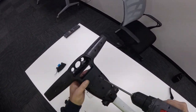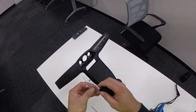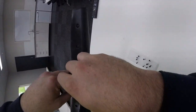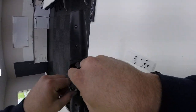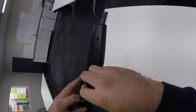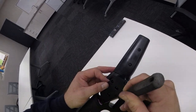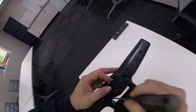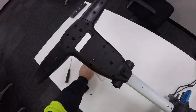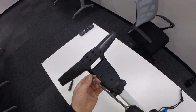So the screen has been reassembled. We'll go with the speed controller next. Plug the ribbon back into its port — it can be a little bit finicky and tricky because it's quite small, so just have a little bit of patience and you'll feel it click back in. Then tuck the ribbon behind the port using a little flat head screwdriver so it doesn't get damaged. Then the speed controller goes back into place and fasten it with the four screws.